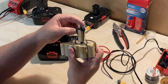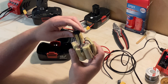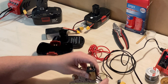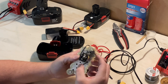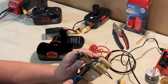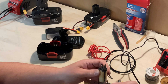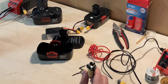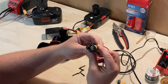Now that we've got the cells out of the outer casing, we need to keep this top piece — this is the part that goes into your 19.2 tools. We have to retain that and put it back into the battery casing. We've got to get this cell loose from this top piece, so first I'm going to cut away all this superfluous stuff to get in here, cut away the bottom connection on the cell, and set that battery pack out of the way.